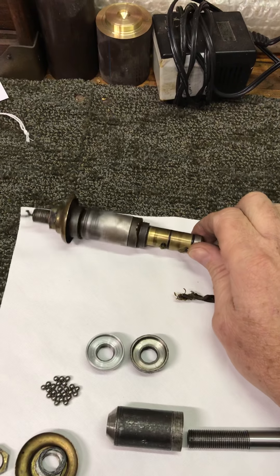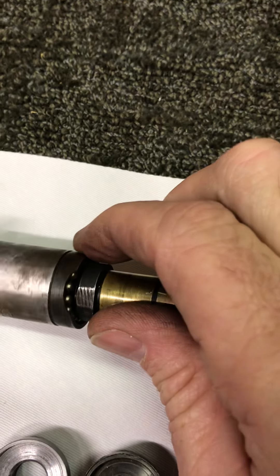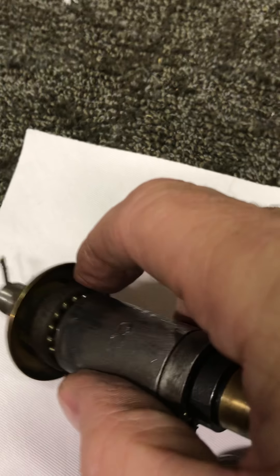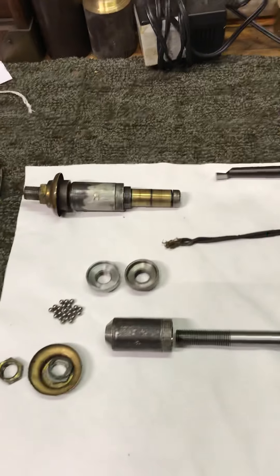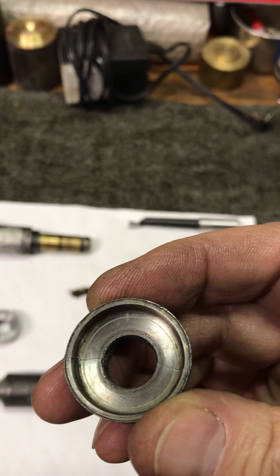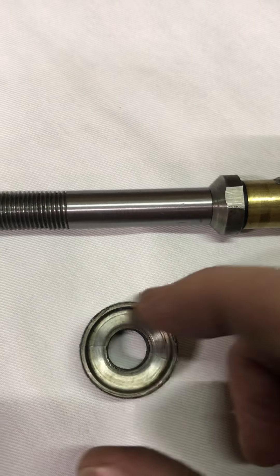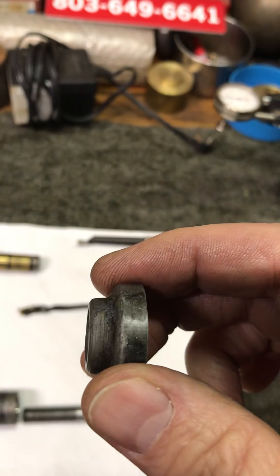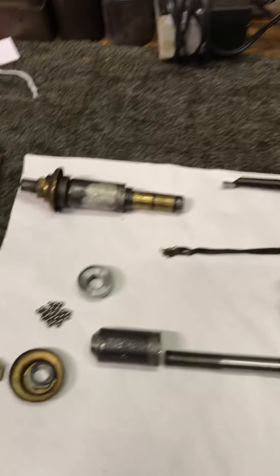A customer sent me two of these that have problems. This one has a broken bearing race right here — you can see the ball bearings, and there's a piece broken out. There's another set of bearings down in here as well. On this one, the original race was broken clean in half — you can see the break marks right there. Somebody JB-welded it back together, but that'll never hold because there's a good bit of pressure on this bearing race from the whole weight of the fan head.